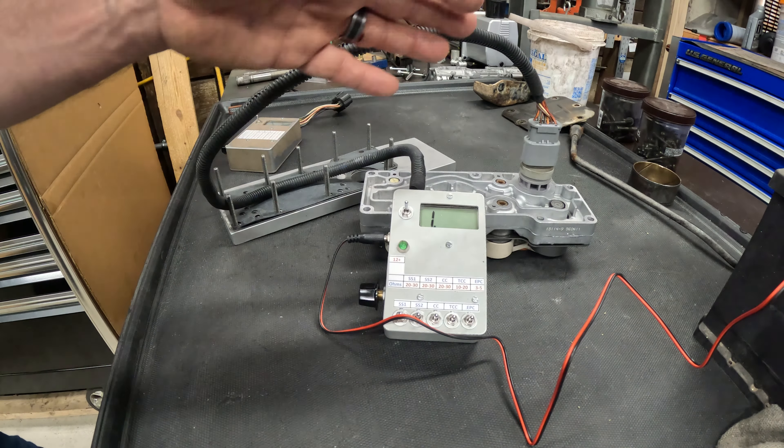The solenoid box does that too — it measures ohms across all five solenoids — but it also applies 12 volts to all the solenoids so I can engage them individually or all together using these switches. It hooks right up to the solenoid pack, and there's a 12-volt port I connect to a battery at the bench. A wall wart usually doesn't have enough amps unless it's a five-amp unit, so I just use a small battery from my wife's Honda — works just fine.